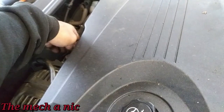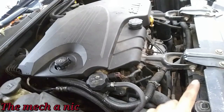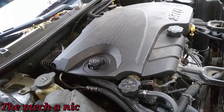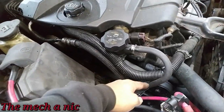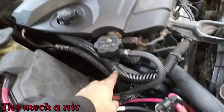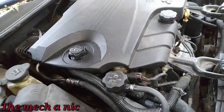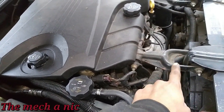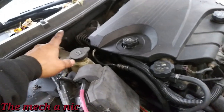That threw a red flag for me. I remembered when I was putting on the starter there was a wire coming off the harness that was tapped into the power side. I tried to trace it back into the harness but couldn't figure out where it was going — I thought it would be coming over to the battery. For right now I'm going to leave it disconnected, because if it's a cut wire somewhere and we connect it to that starter stud, we're going to have a live wire just dangling around. But now I think about it — that wire goes from the starter up the harness and directly to the alternator. That's why our alternator is not charging.